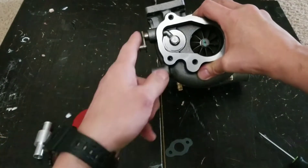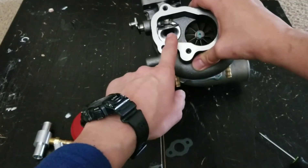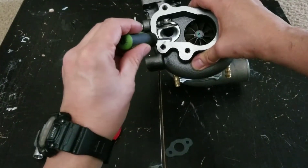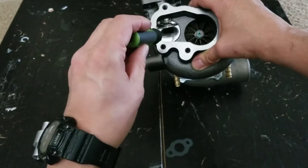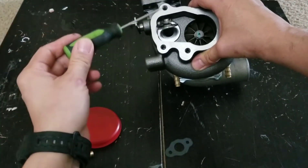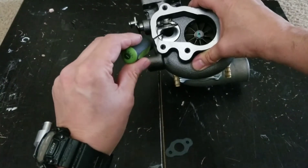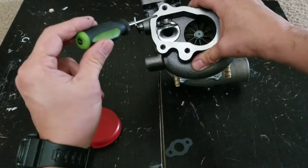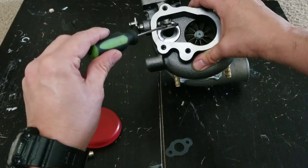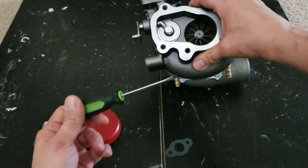For many of us, the drain hole or discharge hole for the turbine housing is sometimes too small depending on what kind of pressure range and what size of engine you have. I'm not going to port it. In case I need it, we think about maybe just closing it — you don't want to touch anything here, and using an external wastegate is probably the best solution.